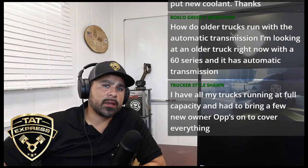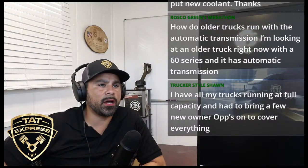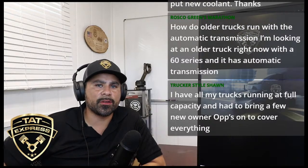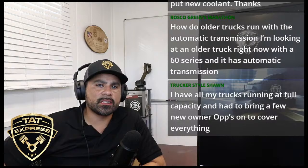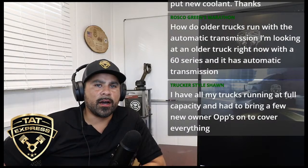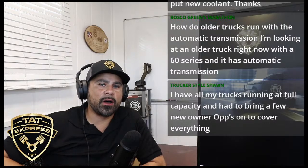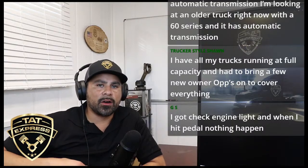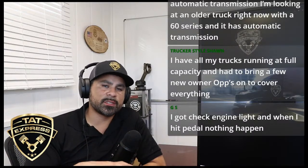Guys, so again, when you're looking at coolant bottles, and I've mentioned this in a lot of my videos, keep an eye on that coolant bottle. That coolant bottle is going to be your first line of defense. If you got discoloration going on in that coolant bottle, or excessive pressure and some overflow, we got a truck in the shop right now that we're going to do a video on, and I noticed that they put a screw in the overfill hose. Most coolant tanks are going to have an overfill section, like Transport mentioned. On a DD15, you're not supposed to have coolant in the entire bottle. There's going to be sections at the bottom on the driver's side of the tank that are going to be empty.